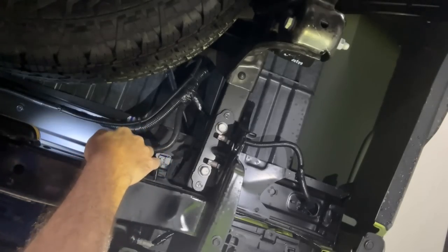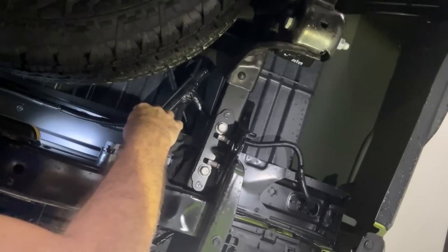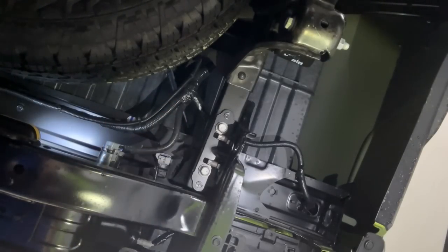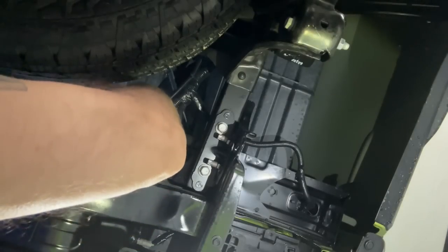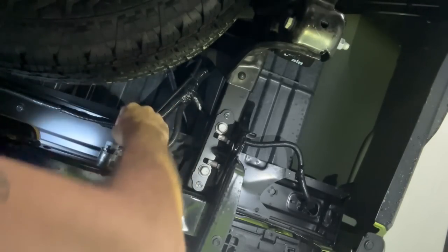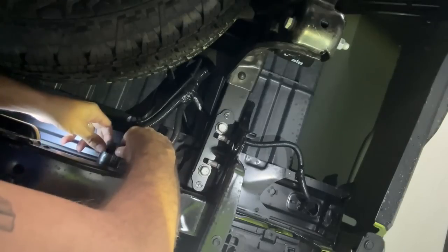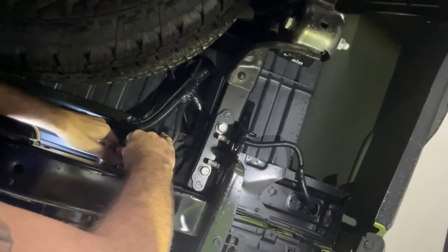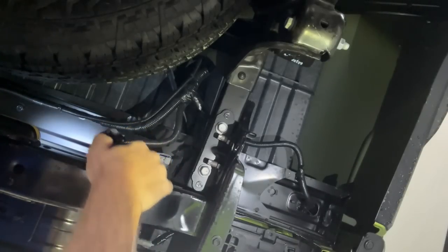The guts of the whole unit of course is the light itself. It is LED — should be pretty cool. It has these little tabs here that hold it into the receiver. You can also remove these tabs and slip a hitch pin through to hold it in so that somebody can't steal it — probably something I will do. That's it, so we need to go ahead and crawl underneath the truck and get it installed. We're under the truck and what you want to disconnect is right here — there should be two little push areas, one on each side, that you squeeze.